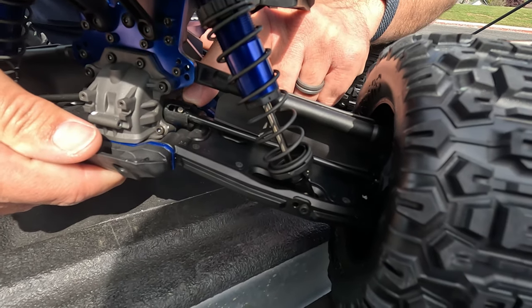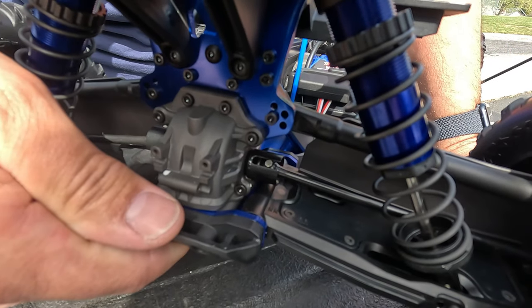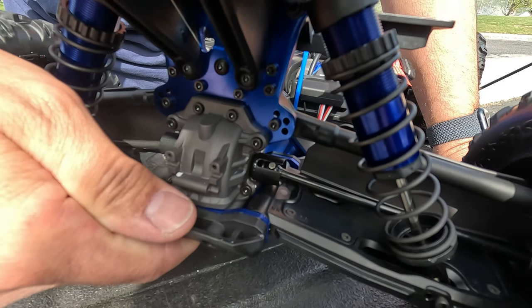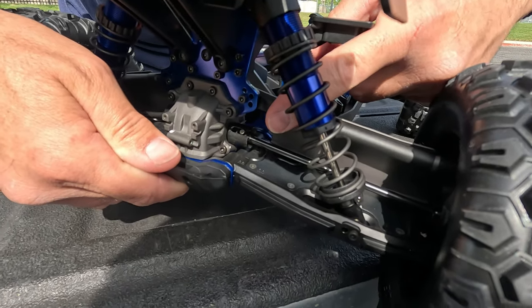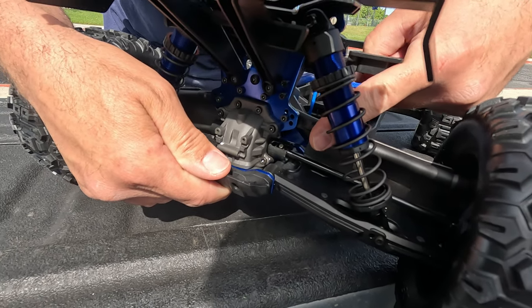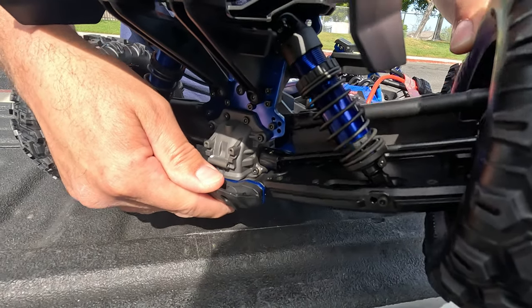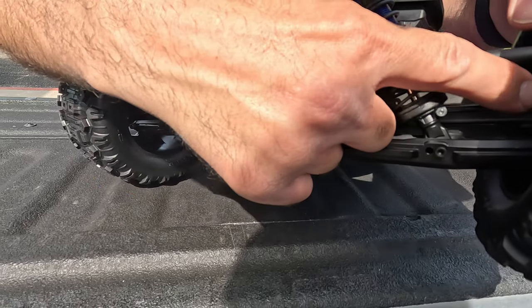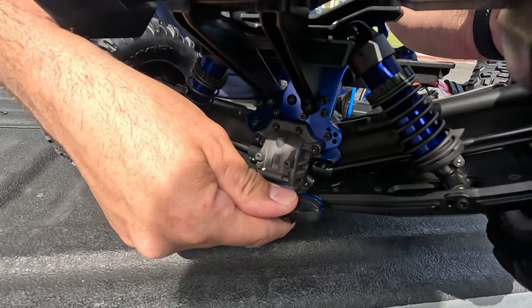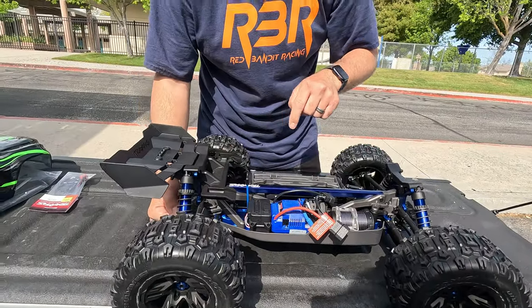This inner cup right here, they actually put an O-ring on the inside. I believe it's part number 6820. Don't quote me on that. I will leave it in the description. But what they did is they put an O-ring inside it. So what that does is that takes up some of that gap. So that way when it flexes all the way up, it pushes in a little bit, and it doesn't let that dog bone on the inside pop out, because that's what was happening. And a lot of people were using limiting straps on this.